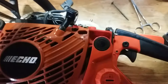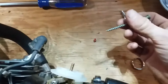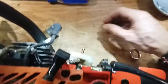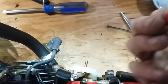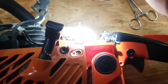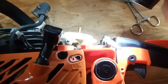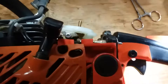The videos I did find recommended using a deck screw like this to stick down and screw into the plastic cap and pull it out. But the problem is, you can see those little notches on the cap — those have to be lined up down in here so they'll come out. When you screw that deck screw in, depending on where your carburetor is adjusted, you may rotate it so that the little tab is in a place where it can't come out.